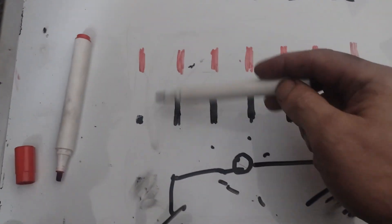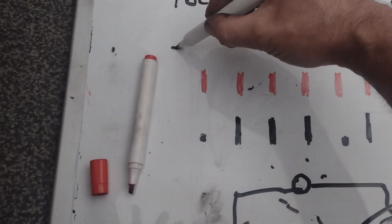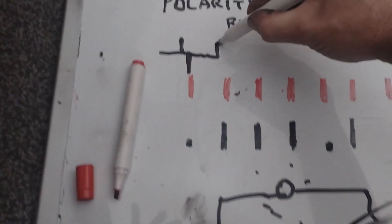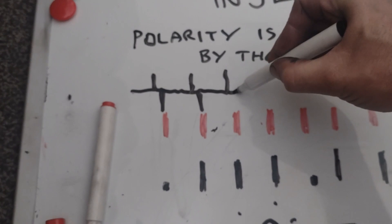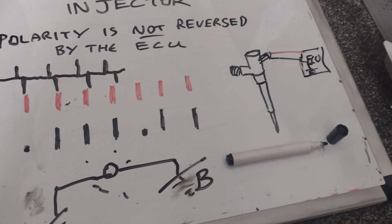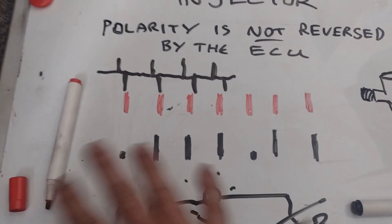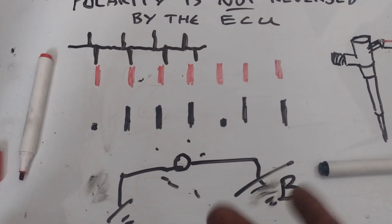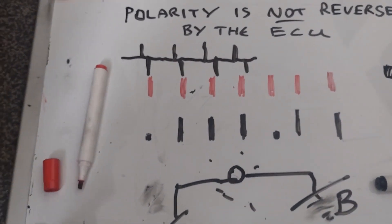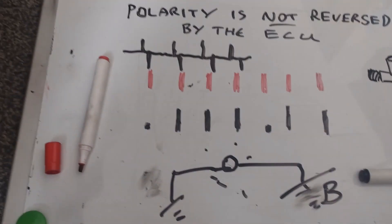The black wire would now be power if it was being reversed by the ECU — and that never happens. Although we do see a waveform and the amps goes up and then down and then up and down, crossing over, it does look like that. But my point is it's not the ECU reversing the polarity — it works in a similar way to a diesel solenoid injector from what I can see. The evidence is there: it simply doesn't switch polarity. What we're seeing in the voltage is a character of the piezo crystals, not a result of ECU control.